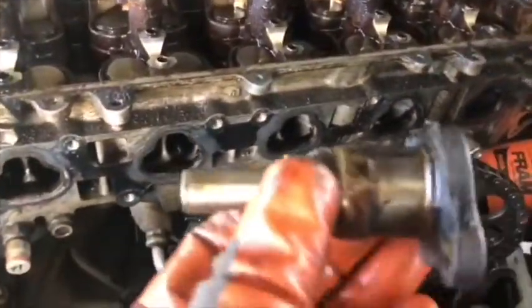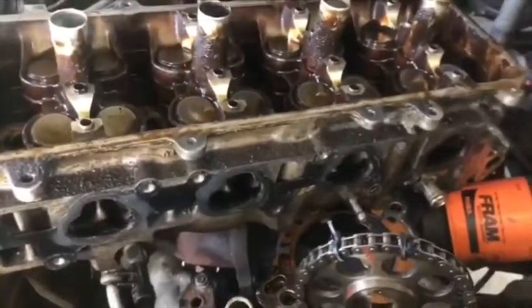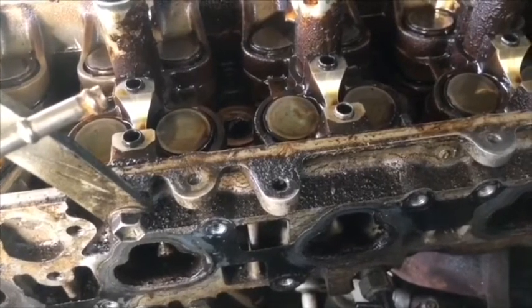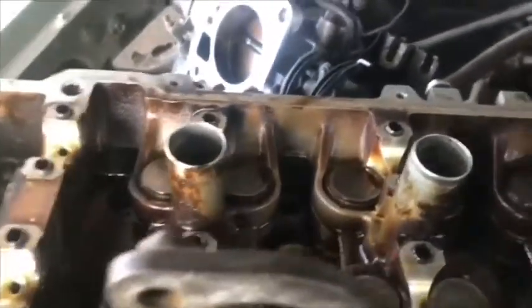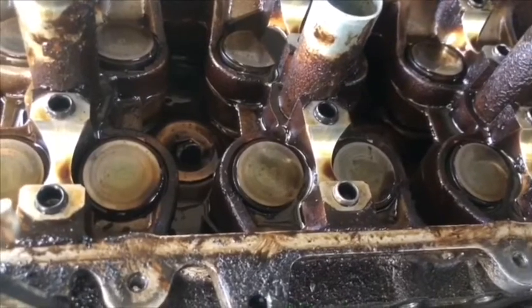Okay, what I wanted to share with you is that I have already removed the bolts from the head. I removed the chain tensioners, and already have the head outside. On the left side, I disconnected two heater lines, the water heater lines, and on the front, left and right side, they got a block for the temperature and the knock sensors. And you see in the picture, we don't need to take off the chain and pull it because they stay in place; the head has room to pull just the head outside.